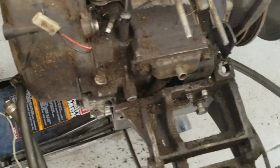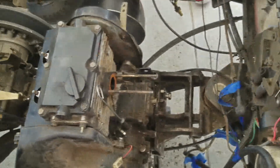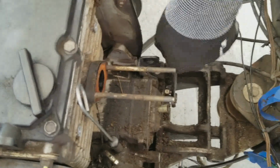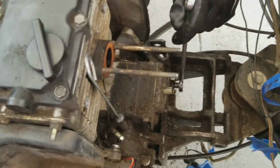So now we've got that out. We have two more mounting bolts left to take out. I'm sorry that I'm kind of getting off on the filming because this takes like 4 hands. Well, at least 2, but it certainly is helpful if you have somebody helping you. You want to try and take out that front? What size is that again? 5/8? Yeah, and this one we can't fit in anything but an open end wrench. We don't have a ratcheting open end wrench, so that would be nice in this instance, but that's 5/8. I think I said it already, all the engine mounting bolts are 5/8.